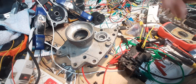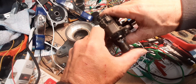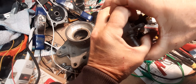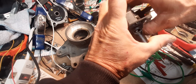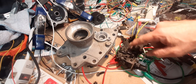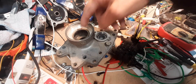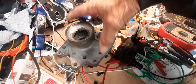To compensate for that, this actuator has got a coil spring inside of it — you can just see the glint of metal in there. It's spring loaded. I can compress that spring even though the actuator is still in its fully engaged state. That way, if the gearing isn't lined up and they're butted up against each other when you shift to a four-wheel drive mode, the actuator is still going to do its business inside. Pushing against the other side of that coil spring, the plunger won't go because it's hitting the gears. Until you get a little bit of motion, the gears line up, then the spring-loaded mechanism will force it down the rest of the way and you're in four-wheel drive.